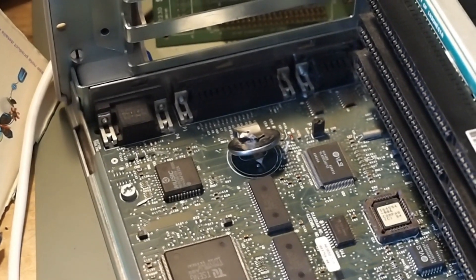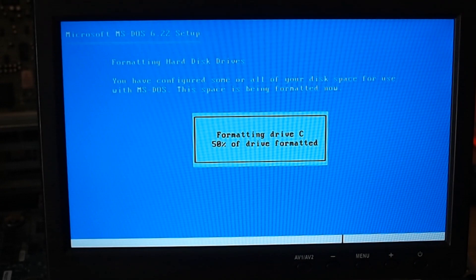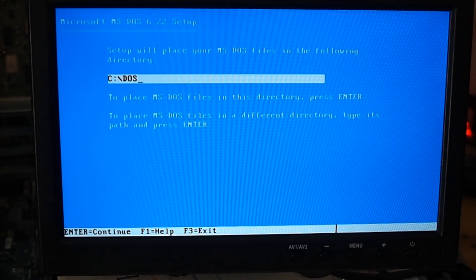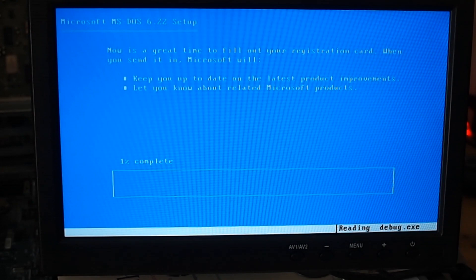So here's the close-up of the BIOS battery again — it's hard to describe but it's all welded together. So I did manage to get that battery changed with a temporary fix. What I basically did was remove the battery and put in the CR2320, and just forced the contacts together temporarily just to see if it would accept the battery — it's a slightly different battery.